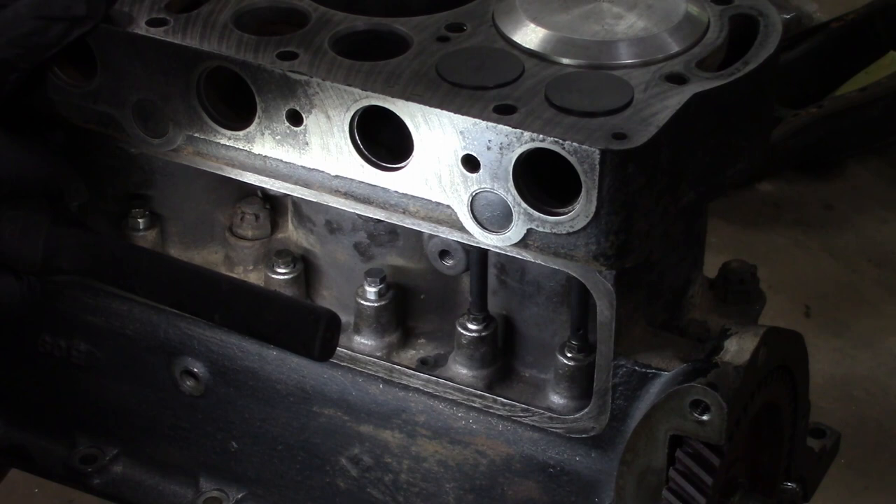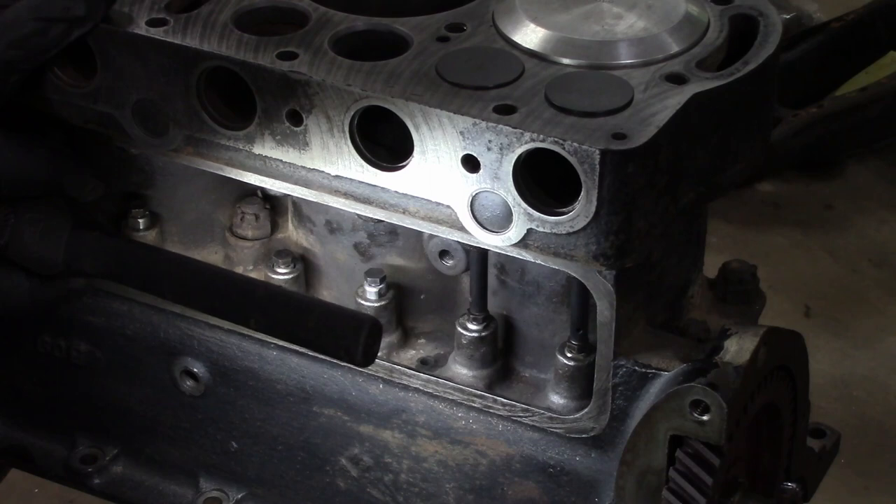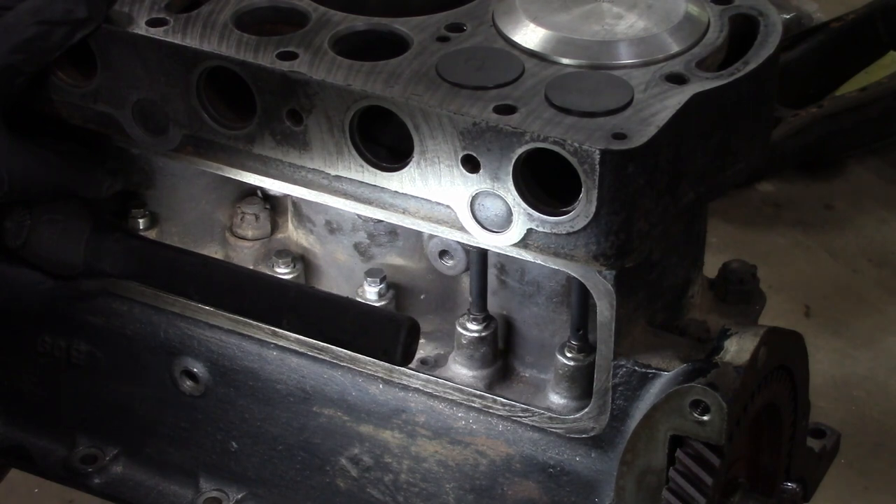So in the next video, we're going to take out the valves — we'll keep them marked — remove the camshaft, remove the lifters, mark them as well, then do a good final cleaning on the block. Then we get to put the new cam gear on, put the cam and lifters in permanently, put the two lock bolts in, then adjust the valves without the springs, install the springs and the keepers, double check them, and the valve train is done. So at least we are moving forward here, folks — stay tuned, like this video, subscribe, ring that bell, and go ahead and comment. Thanks for watching, see you next time!